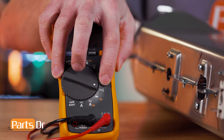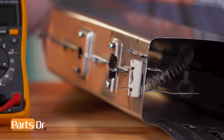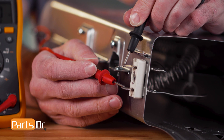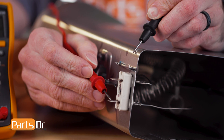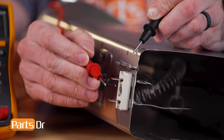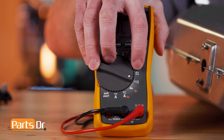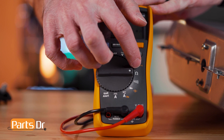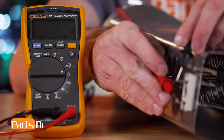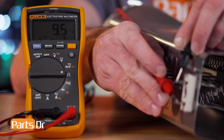Next, we will use a few different tests to check for a bad heating element. First, use a continuity test to make sure the heating element isn't burnt out or broken — you should hear a beep when placing the probes on each of the heating element's terminals. Then, test to see if the heating element is shorted out by placing one probe on the heater's metal casing and the other probe on each of the heating element's terminals. If you hear a beep, the element is shorted out and needs to be replaced. Finally, test the heating element for the correct resistance by setting the multimeter to the ohm setting. If using a manual ranging multimeter, set it to the lowest ohm setting. Touch the probes to each of the heating element's terminals — you should get an approximate reading of 8 to 10 ohms. If the reading doesn't register or is outside of 8 to 10 ohms, you may have a bad heating element.